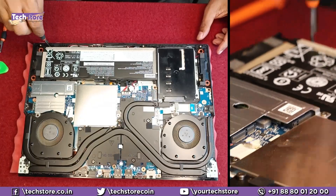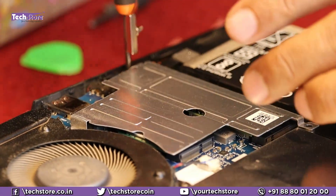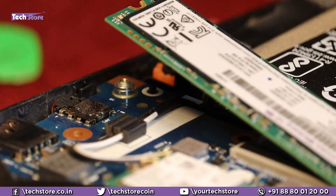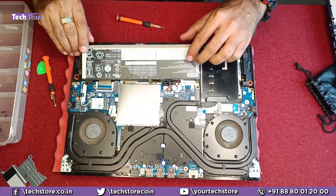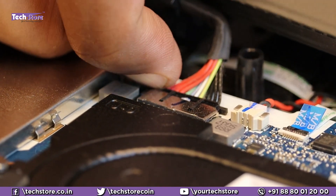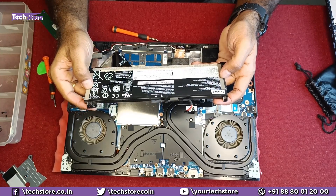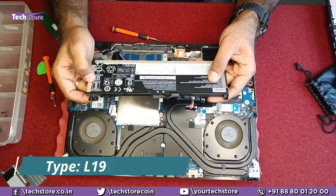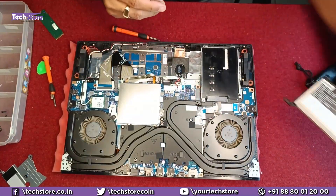Let's start with the battery. Remove the screws, open the covering — three screws have to be removed. There is a heat sink on top of the M.2 SSD, so open that first to get access to the battery screw. Once the screws are removed, gently pull the connector out and the battery comes off. This comes with a 60 watt-hour battery; the ratings are 17.6 volts and 58.5 watt-hours. The type code is L19C4PC0. Take a similar battery and you can replace it comfortably.